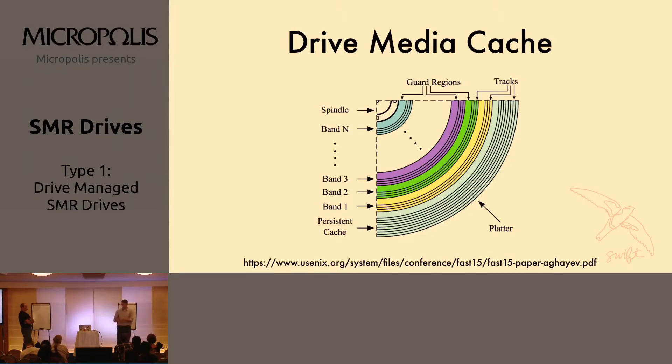When you start running out of cache space, you're going to have a performance hit. That performance hit starts being experienced around 30 gigabytes of bytes written or about 200,000 writes, whichever comes first. If you're writing very large files, you'll probably hit the capacity limit first. If you're writing very small files, you'll run into the operations limit first. This is basically the state table the drive is managing — after accepting those 200,000 writes, it needs to flush them out and reorder the writes to go out appropriately onto the SMR bands.